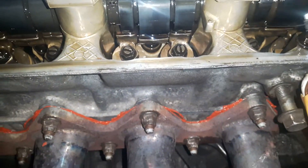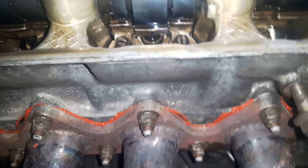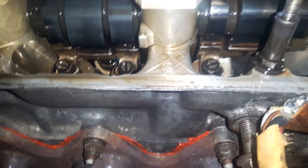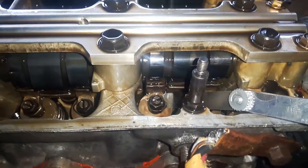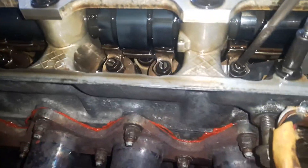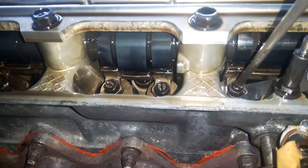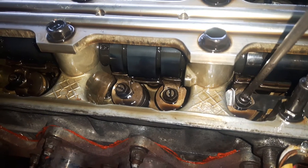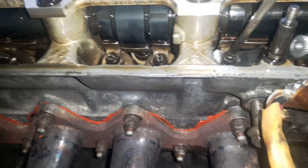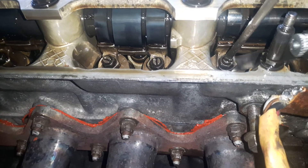Right now it's very loose. Loosen the lock nut and adjust for both of them, then go back to the intake — it should move with slight drag. Sometimes it's better to tighten it a little more so that it doesn't move well, then loosen it to find the sweet spot. Like right here — it's about right.